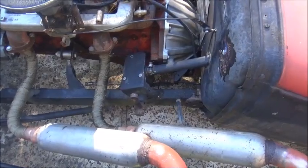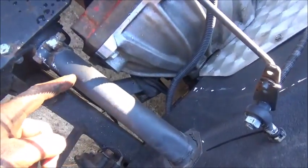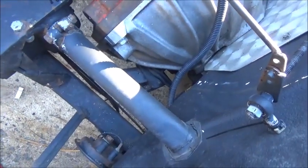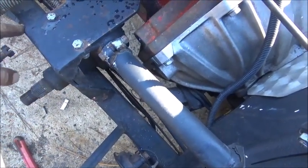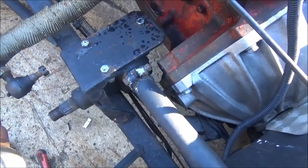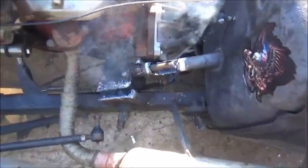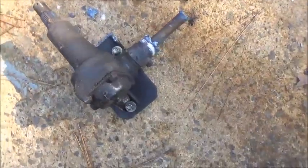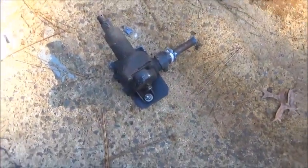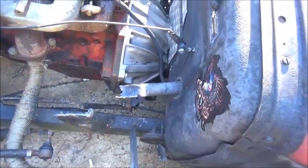Put my arms off, got it up close to the shop. I think I'll cut this outside tube down low and cut the inside up high, just in case we ever need to use the box — we can put a u-joint on it. Then I'll cut this mount off and weld it out of the way so we can get the steering gearbox out. There's our culprit — that's our problem. Weird looking box. We might pull the cover later and see what's wrong with it, but for now I'll get this cleaned up and get this column out of here.